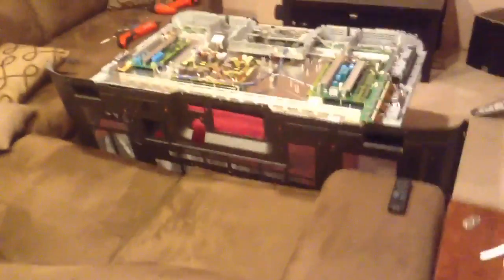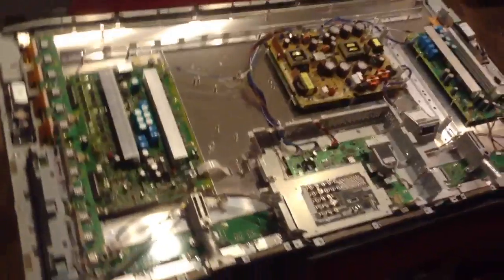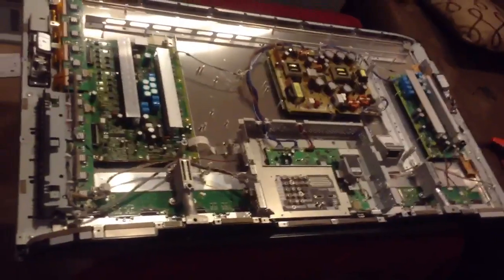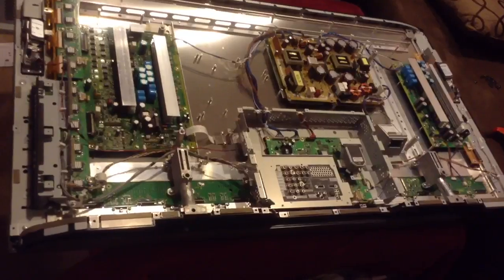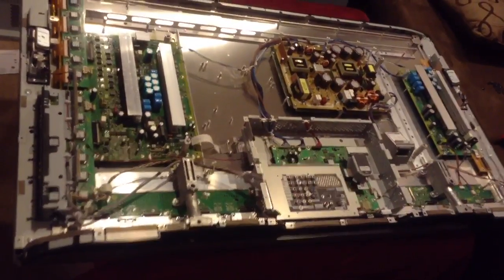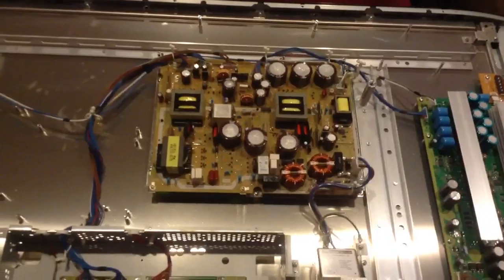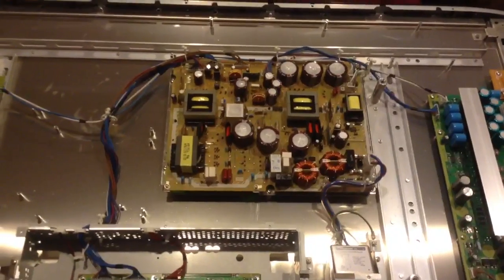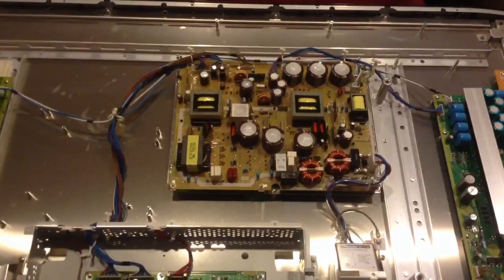As you can see, the metal cover on the back of the TV has been removed. Let's take a look at the components inside this plasma television. Keep in mind, plasma TVs and LCD TVs are going to have very similar components, but plasma TVs may have a few more because there's more electronics needed to make them work. The large brown component near the top is the power supply, and those very large capacitors are holding a lot of electricity. If you bridge a connection on them and they still have power, it can kill you.